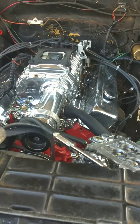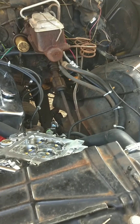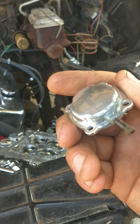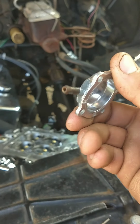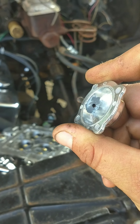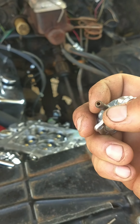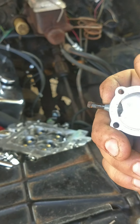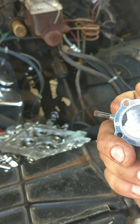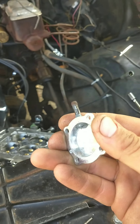All right, so back to this power valve thing — now that it's like three o'clock the next day. Last night I drilled my little power valve cap, put the nipple in and pretty much just JB Welded around it. Does it look pretty? Not really — I guess it'll function. That's the way I've seen other people do it on the internet. I was hoping for a press fit but I just didn't have a drill bit the right size to hammer it in. So this part's done. I let it cure overnight — it's definitely set up and it shouldn't go anywhere.